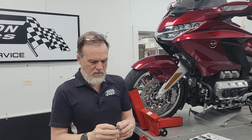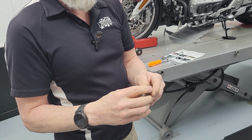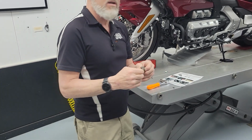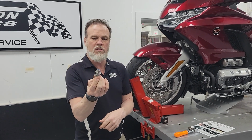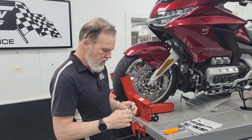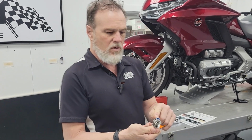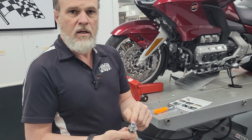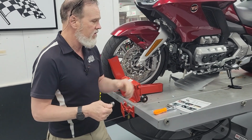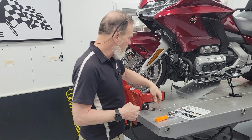Also, the Wing Stuff one just comes with a small little washer, and it's quite thin and small diameter. If you're doing that, I'd recommend finding a thick fender washer, kind of like these ones here, or two of them and stack them. The Chinese one also included a nylock nut, which I think is good. The Wing Stuff one has a serrated flange, which is good, just not as good as a nylock for this application. That's the only thing I'd say about that.